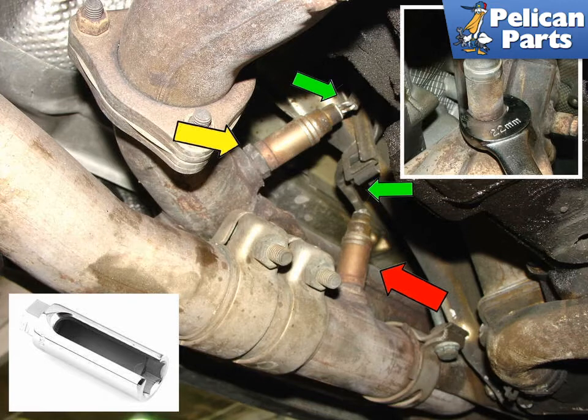The green arrows show the wires that go to the engine shelf where the connectors are located. I have often found that the new O2 sensors come with the correct plug, but sometimes the cable is way too long. If this is the case, secure the cable with a nylon zip tie.